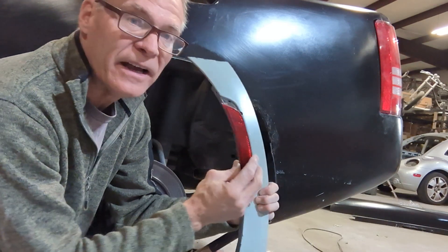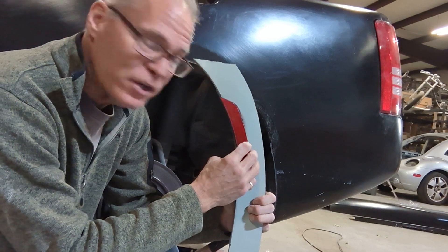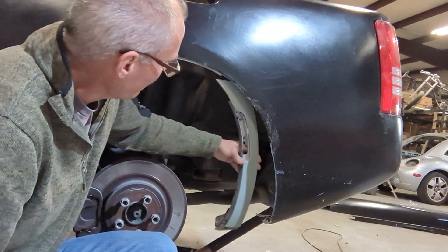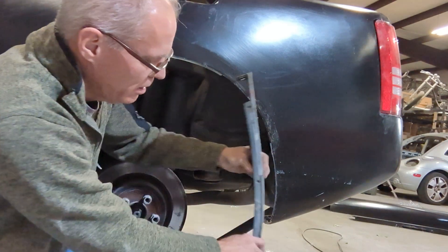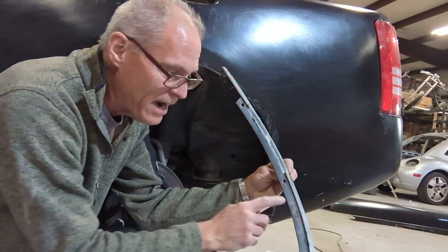Here's the light — the light goes right in there. You can space it out an eighth of an inch if you wish to have it flush like the original. Remember, this is an eighth of an inch thick. Or you can leave it as it is, bond the whole thing under here, bolt it up and panel bond on the edge sliding underneath here. That keeps all of these factory inner wheel liner mounts intact.